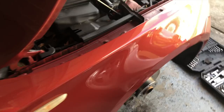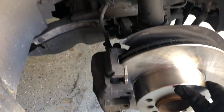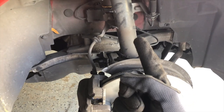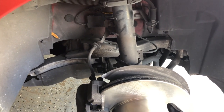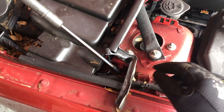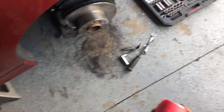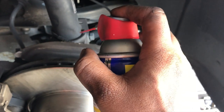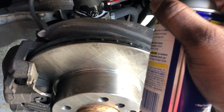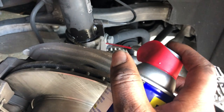I have the rear done and tires back on. I also went ahead and changed the rotors and brake pads all the way around. All that's left is to do the front suspension, which I'll tackle tomorrow since I don't have enough time today — there are about six or seven bolts to take off and then everything pops right out. Before I'm done for the day I'm doing the most important thing: spraying WD-40, or PB Blaster would be better, down into the joints and letting it sit overnight so that tomorrow the shock will slide right out of the knuckle.